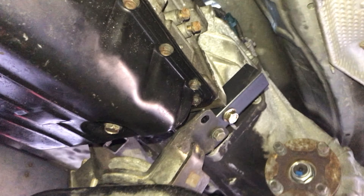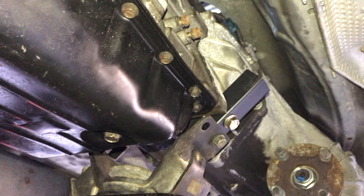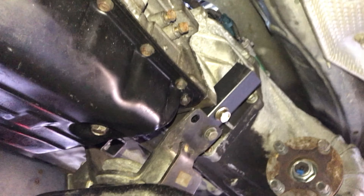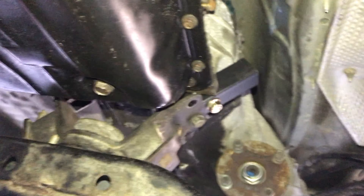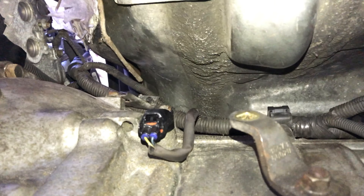Taking a look further down — I made a mount for my transmission adjustment. I took some 1-inch, 1.25 steel square tubing and made an extension for that on both sides. It's a little long on the ends, and I wasn't able to get something in that second hole, so it may be a little weaker than original. I still have to hook up the front driveshaft, but I'll do that after I get the exhaust in. With the 2-inch body lift, there's a ton of room between the floorboard and the floor pan to get my hands in there.